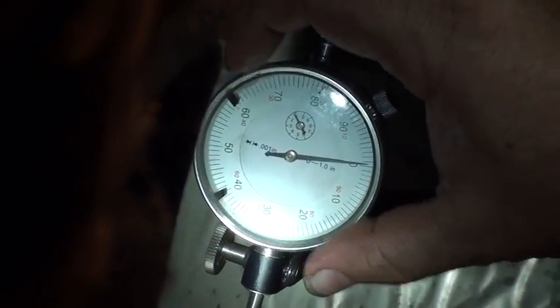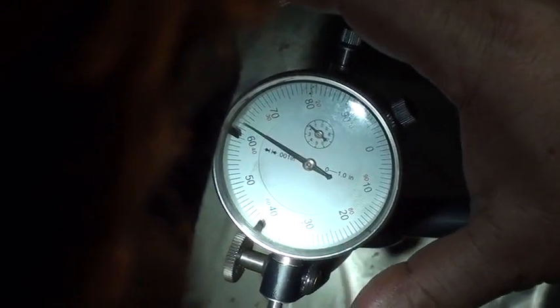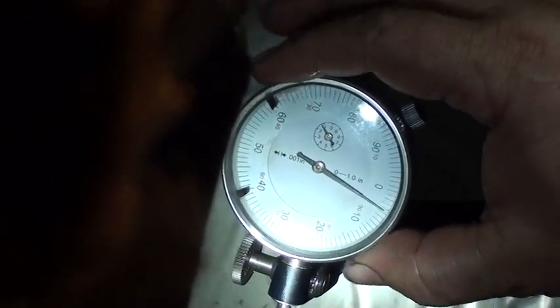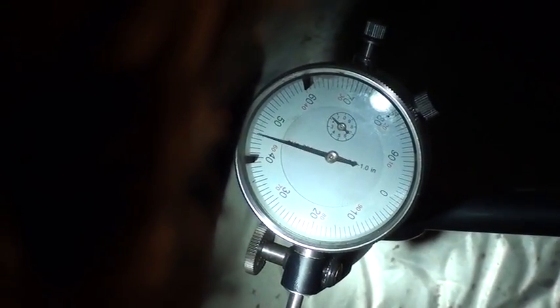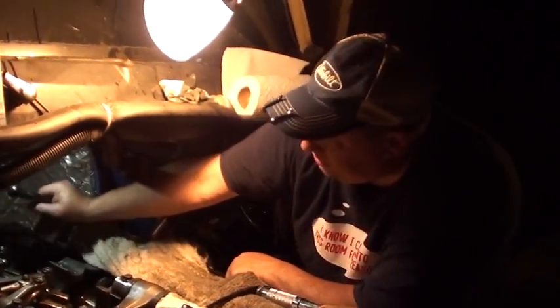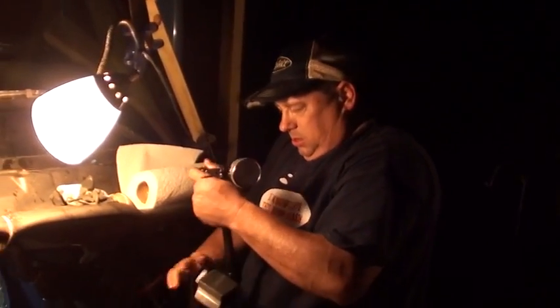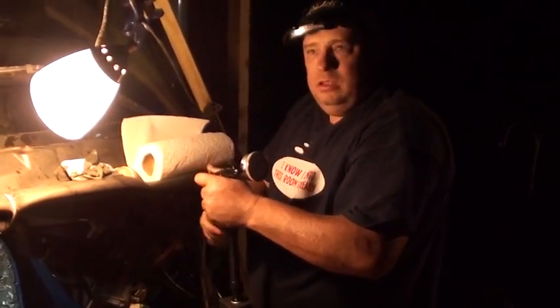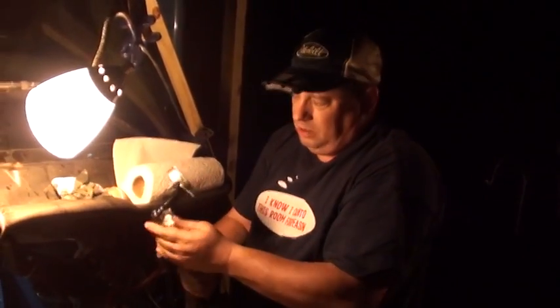Just this one - that one's got a lot in it, that's the most. We could tell when we were feeling it - it's about 50 something. It's well under 110 though, so we know for sure that it's good. Just double-checking ourselves so we're not wasting our time when we go to run the overhead - we don't have to readjust any bars or rocker shafts.